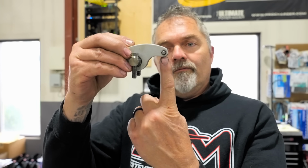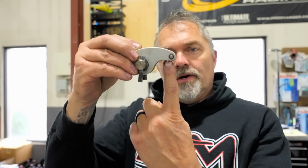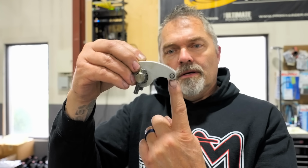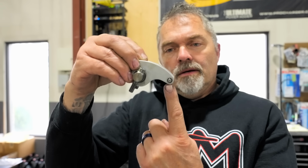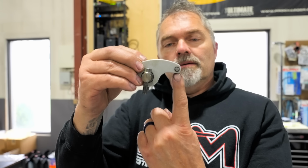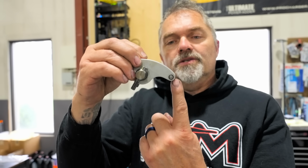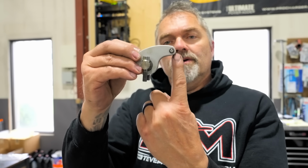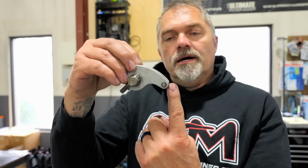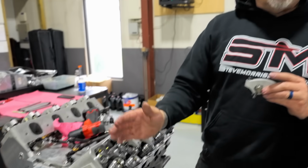Now, as you would move this through its motion of raising the stand, if this was my valve, it's going to basically start over exaggerated. It's going to start over here, and as it goes down, it comes across, and then let's see, hold on. So it starts over here on the back side, comes down right in the middle, then comes down and goes a little bit over here. So let me do this real exaggerated. Starts here, in the middle of the sweep, middle of lift, it's there, and then it goes back down to over here. Very exaggerated, okay? That's where you get that sweep.